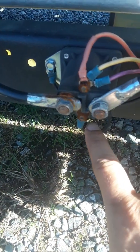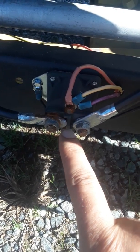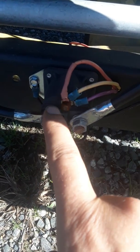You've also got a ground, and then you've got all your run things. These are when the key's on, these have power. Once you crank it over and start it and it backs off, the key is in the run position, which means these all have power. You'll note there's this little wire coming off over here. A lot of these solenoids have a grounded base plate, and if you don't have a metal contact for it when you screw it down, it won't work right out of the box simply because it does not have a ground. You have to wire in a secondary ground. In this case, I have a coating on my frame — it does not get a ground, so I had to wire this separately. It was very frustrating to figure out, but this is what continuity checks are for. This is why we use multimeters.